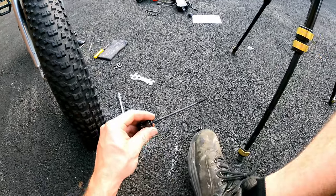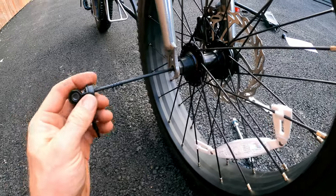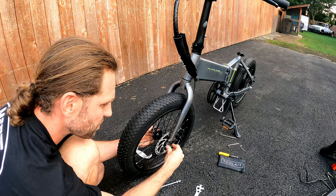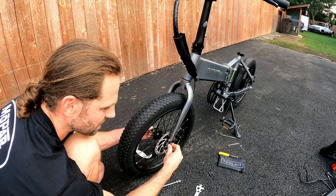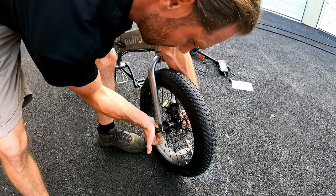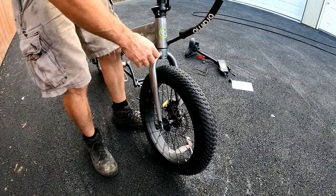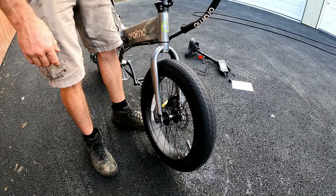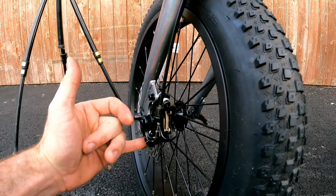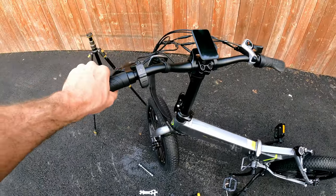Note there's nothing keeping the wheel from popping out — it does have a spot for one of those little safety washers, however that's not included. Slip the axle in from one side; you've got the spring and little rubber grommet, and on the other side spring and nut. Your cam lock should fold over with fairly stiff resistance. Lift up that front wheel — it spins straight and true without a bunch of dragging. You may need to adjust the brake caliper using the two 5mm bolts where you have some wiggle room.